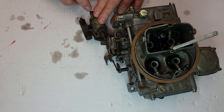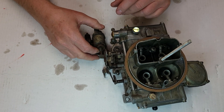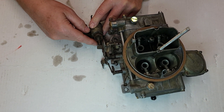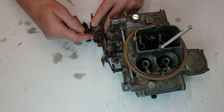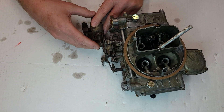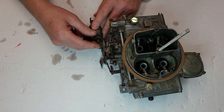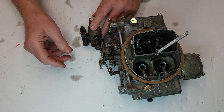So when you'd turn the ignition on, it'd put 12 volts here and this solenoid would pop out. It won't push the throttle open on its own, but you have to touch the throttle, and then the solenoid will hold it open from then on — so then it's idling from this solenoid. You adjust the idle speed right here with a 5/16 wrench, and you set the idle speed to like 800 or 1,000 RPM, whatever you needed. When you cut the key off, this dropped down, the throttle closed to almost cutting the motor off — 400 or 500 RPMs — and it won't diesel because it can't get any air or fuel.